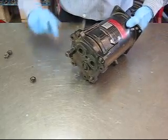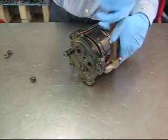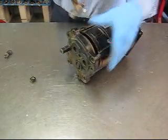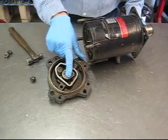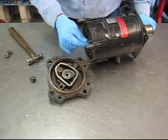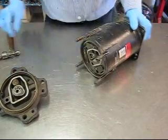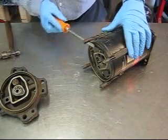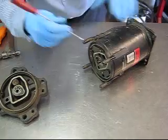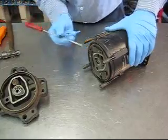Gently tap off the back — that's the rear cylinder head. The oil pump is located right in the back; it may stay on the crank when you pull it, so just keep everything together and note the positions. Next is the valve plate assembly off the back. It will be a little stuck; you can work it with a screwdriver. Don't be excessively rough — just work it a little bit and it'll come off.